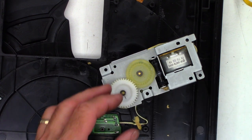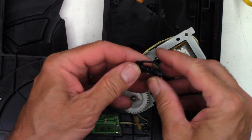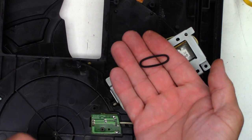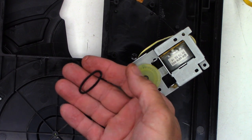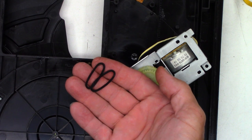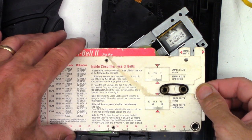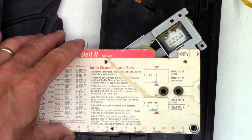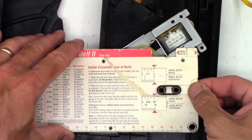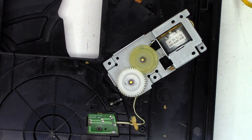It's been reinstalled, ready for assembly. Look at that — we have another permanently stretched belt. I believe it's exactly the same size as the mechanism loading belt. Let's see if I can find another one. It measures just over two and a quarter inches, and the replacement belt I have begins to tighten up right at two inches — so I think that's going to be the only choice I have, because the next size is almost three inches.